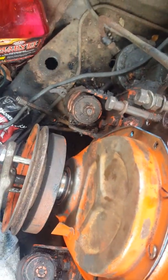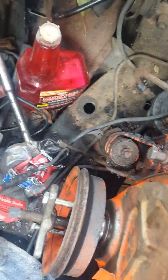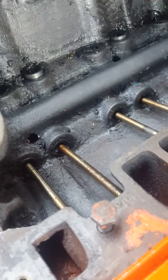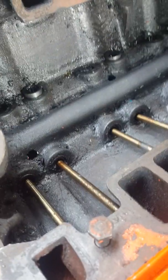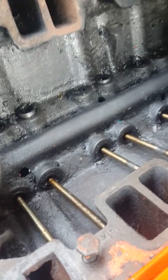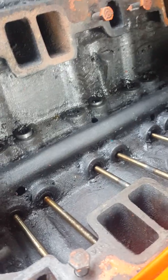See? Okay. The other way I know that this is correct is that the dot on the top gear, the top cog, whatever you want to call it, is pointed directly at 6 p.m., okay? That's where that belongs. Another indication of me being right is that both lifters are down, they're flush. So it went through the exhaust stroke, which is the first one. It went through the compression stroke, which is the second one, and closed. Okay, so that tells me I'm right.